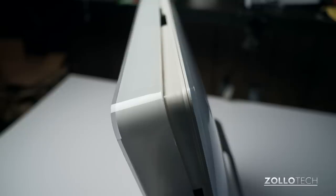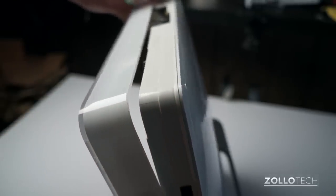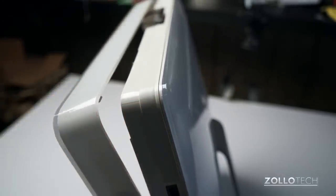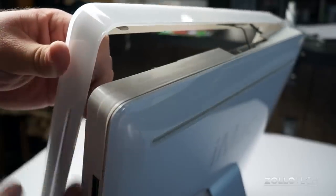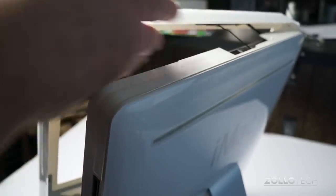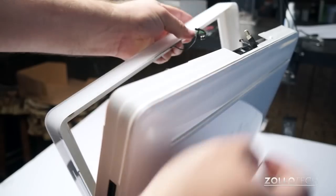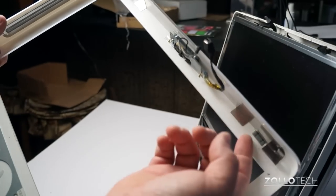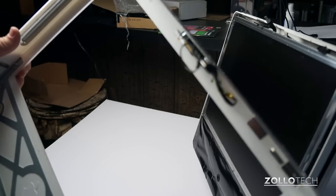Now you can see I have it loose and we're going to pull it back a little bit — we don't want to pull it right off. You may have to unhook it from the bottom a little bit, but you don't want to pull it right off because you're going to have to undo this cable here. Now that we have the top and bottom loose, we want to remove it carefully because we have a camera and microphone cable we need to disconnect first. We can then remove the front. This is the mechanism that releases the back — when we were pushing the credit card in, we were actually pushing up against this to release it and it popped the front off.